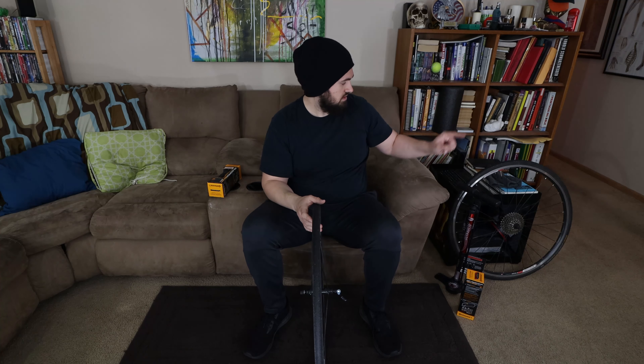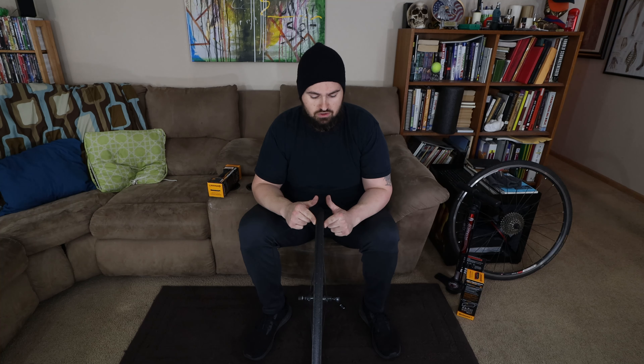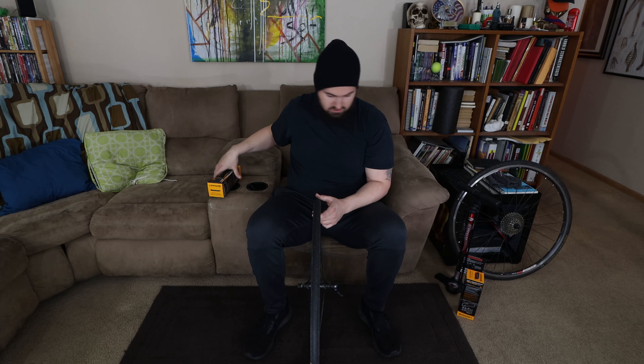I do ride during the winter here in Ohio, and I will say that the salt during winter conditions will affect these tires more — it will induce more dry rot on them. Also, if you're putting your tires on thinking you're good, since these are higher-mileage tires you need to rotate them. I would say every thousand miles you need to rotate. I just rotated mine and noticed a little mark or defect — a potential hole on the sidewall — so I decided to go ahead and buy a new set of tires.